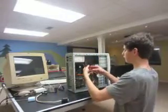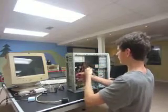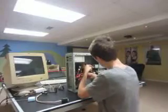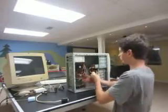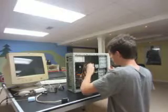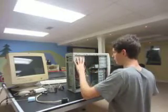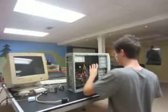Now to power up your drives, you will have to attach your power supply unit there too, and you'll find cables that simply have the right connector for your drives, and simply plug them in. They will kind of click, but they will still be wiggly. So now we have power. Once we turn it on, we'll have power going to our motherboard and also to our drives to make sure that they run.